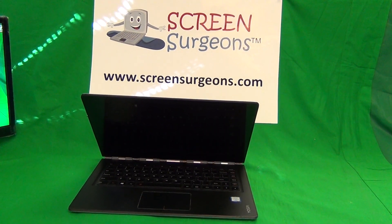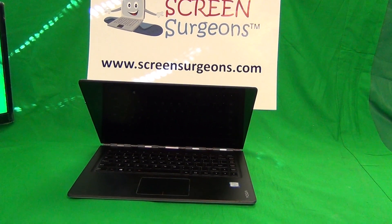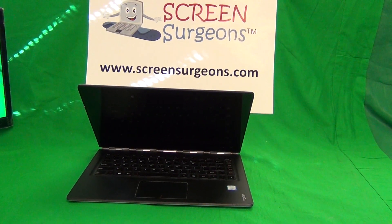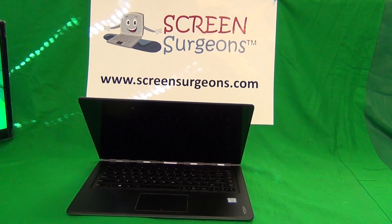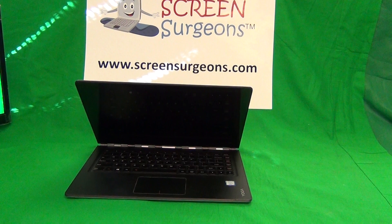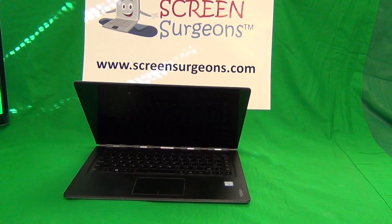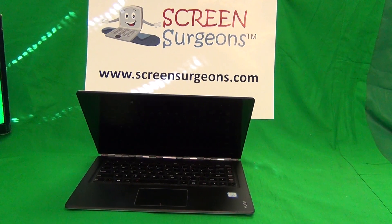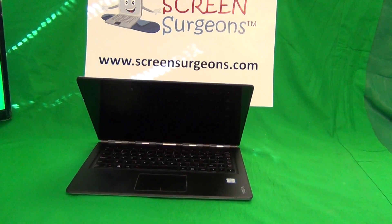For laptops with external batteries it's pretty easy to do — I've done this on many videos, you just snap the battery out from the bottom. For newer laptops that are thinner, or the Ultrabooks, you have to remove the bottom. It has an internal battery and you have to disconnect the battery on the bottom. I will show you how to do this right now.